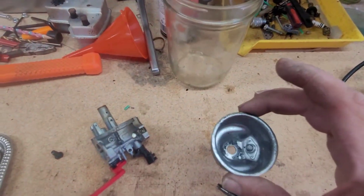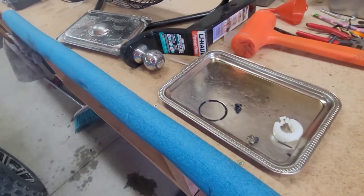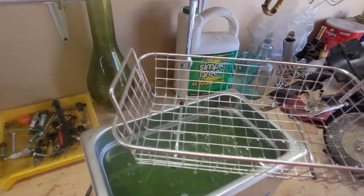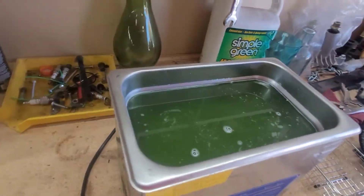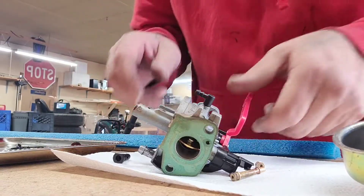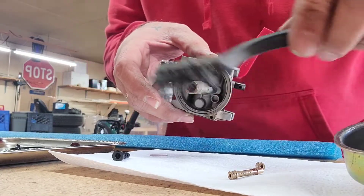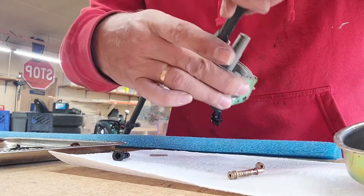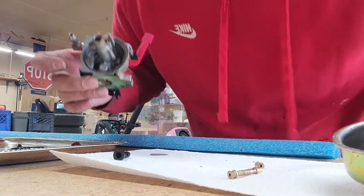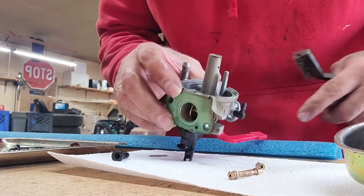Little piece of macaroni but you can blow that out. There's the emulsion tube. The main jet is probably down in there. The only thing I don't have is a little net or basket for this, but I'll bring you back once we get all cleaned up. Now we're going to do a secondary cleaning — get these brushes from the dollar store and do a little secondary cleaning after the ultrasonic, because sometimes it may not get the really rough stuff.